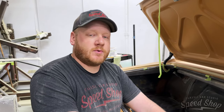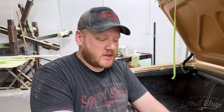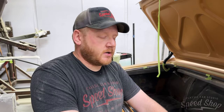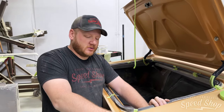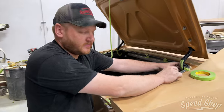And now we're gonna do one final coat of Duratec. Well, it'll be four coats of Duratec. This is a different stuff. This sprays black. Yeah, it's gonna be like a super dark gray black almost. And like I said, we're doing that because it's going a dark green color, so a dark undercoat helps with coverage and everything on your color when you're spraying. All in all, it looks pretty good so far. It'll be good when we're all done.